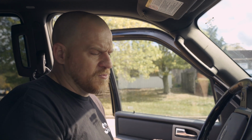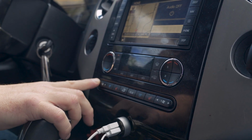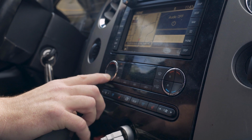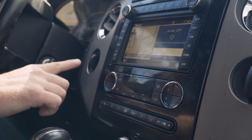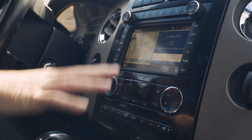He's super smart. And one of the tests that he showed, let me close the door, see if we can hear this. I want to turn the climate control panel on, and I'll turn the blower down so that's not too noisy. What we want to listen to on the driver's side, I'm going to go full cold. We want to listen for some clicking here. I heard it. Oh, it's on auto. I don't want it on auto because we do hear some mode doors changing.